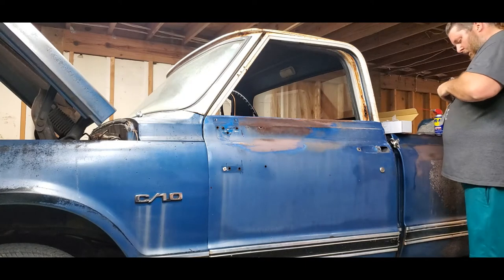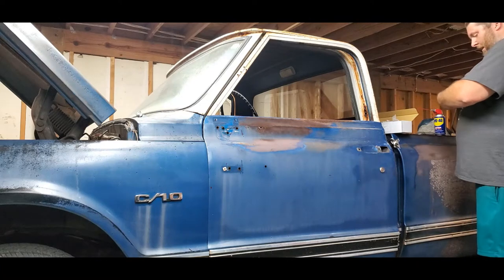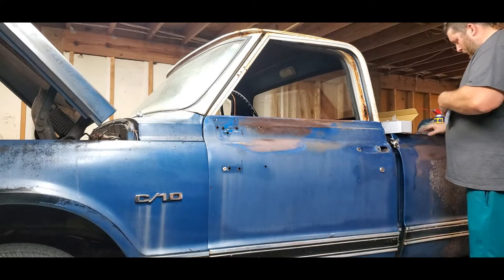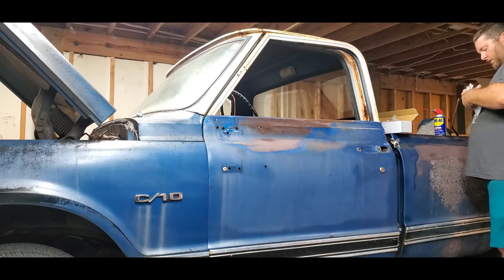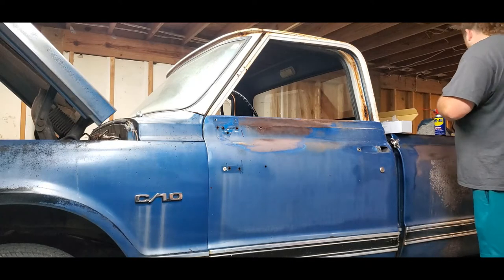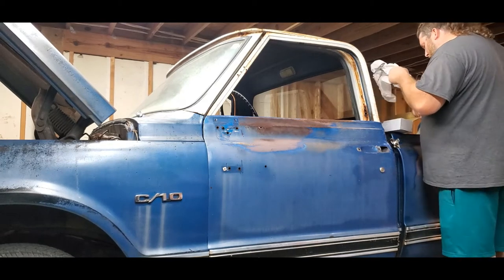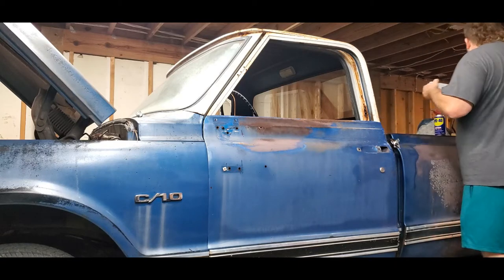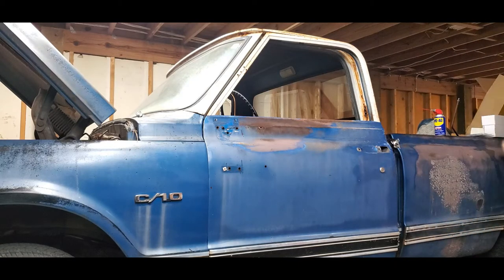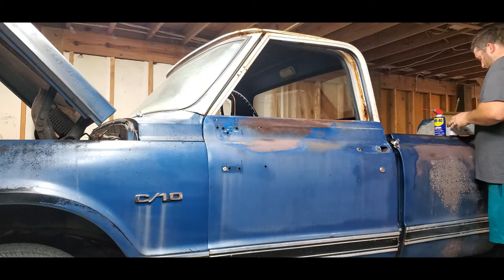The metal backer I'm talking about is just a nut kit, piece of metal with weld nuts on it, and you screw into that piece of metal, then you got a backer that's against the door and your nuts can tighten up against. Some of these aftermarket companies have them. This one doesn't, so we'll have to make something. But it'll look good. It'll be a good looking setup.